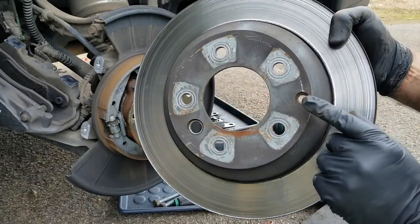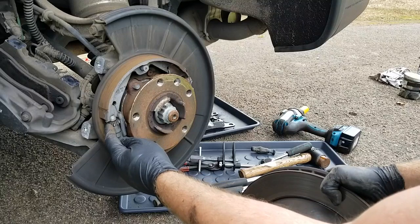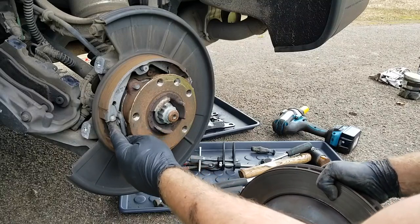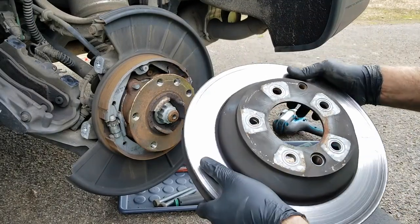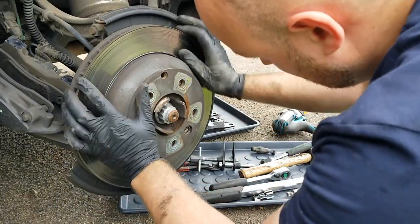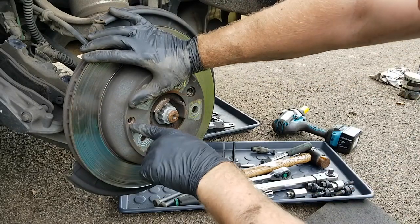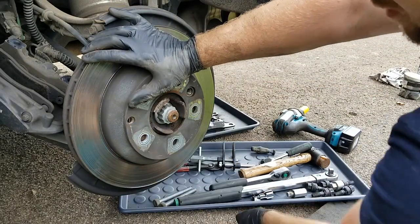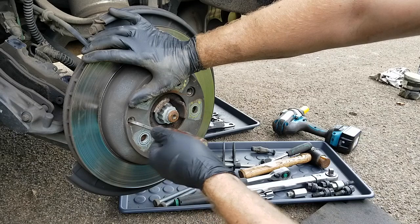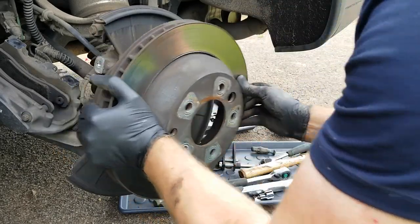It's not too hard. This car doesn't have too many miles. The more miles you have, the deeper the ridge on the inside will be, and that's really what defines how hard or easy this is. The little screw that you unscrewed allows you to access the adjuster. If you are stuck without any tools, you turn the disc until you're in front of the adjuster and put a screwdriver in there to adjust it down.